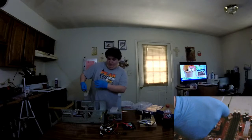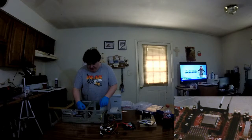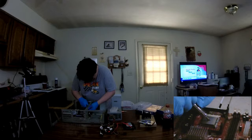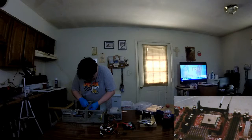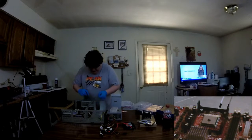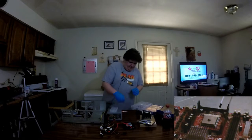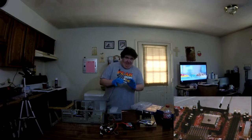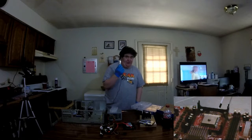I also have a new voice recorder — hopefully that helps with the audio. Now, you'll want to put about the size of a pea, just a little smaller. I am using Arctic Silver 5, as it's what I've always used. Put the cap back on. These are big tubes — they last forever. I bought this like a year ago, and I always replace thermal paste on all my equipment every six months, including game consoles.